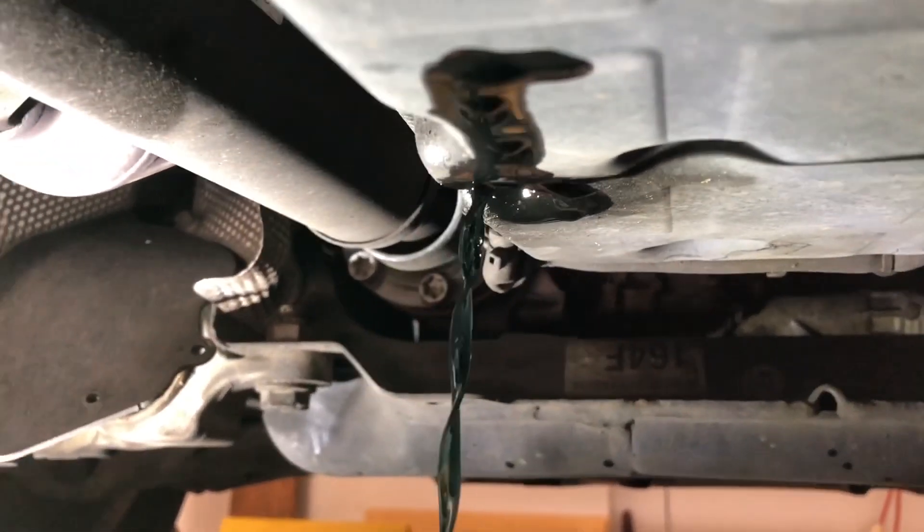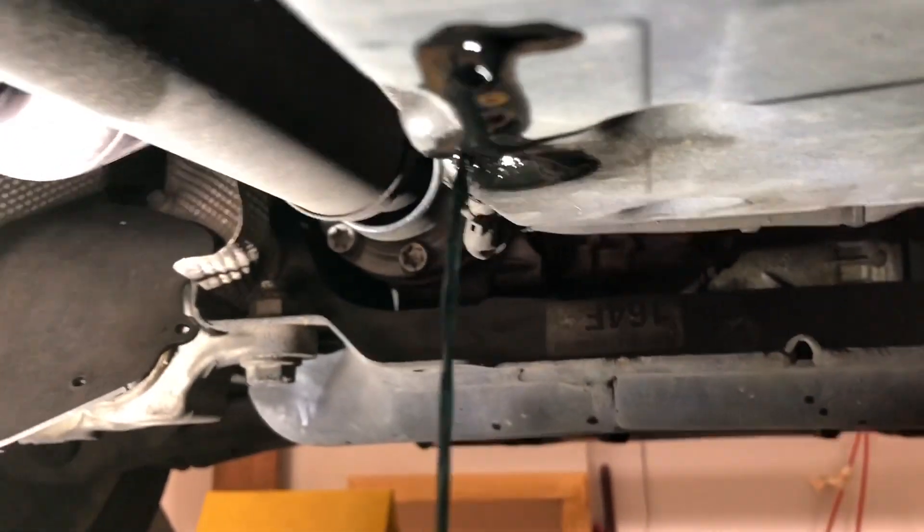The next step is to tip the stand tube over - the stand tube is keeping the rest of the fluid from draining. If you put a small screwdriver in there and pop it open, you can see all we did was tilt that stand tube a little bit, and then you can get the remaining fluid out of the pan so you don't have to deal with that while removing the pan.